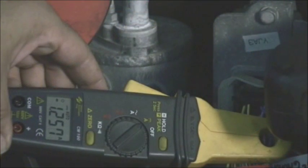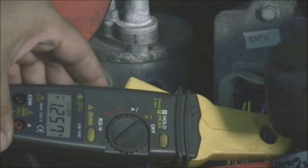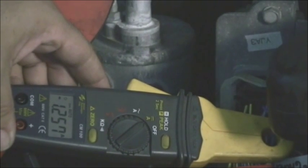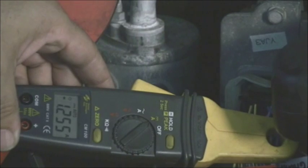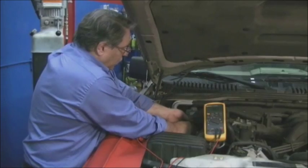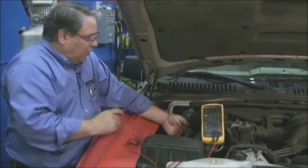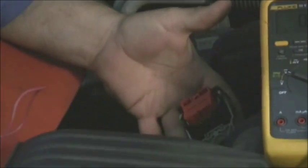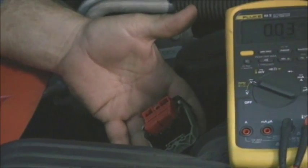Before we do that test — how about some of these portable amp clamps? Always make sure you've got a good battery, zero it, and you should be okay. If they don't have an amp clamp, we're going to show them the solenoid fast check. This is the connector that has all the transmission wires going to it — this is where we were amp-clamped to pressure control solenoids A, B, and C.